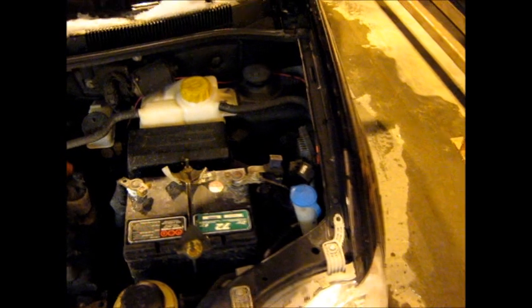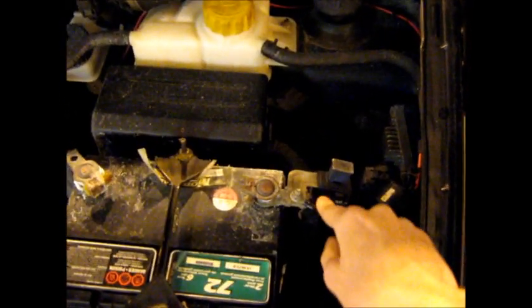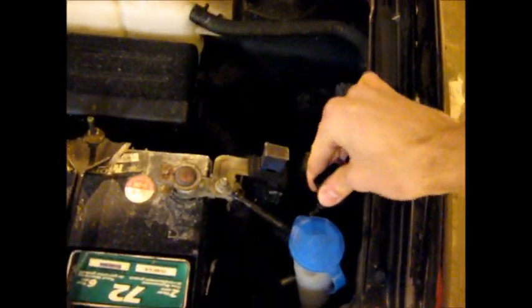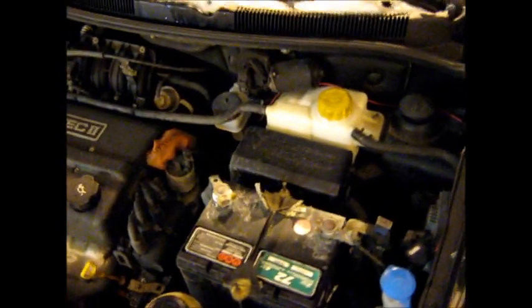So what you want to do is take, I think it was 16 gauge wire, up to the positive terminal of the battery. Make sure you have a fuse on it really close, 7.5 amp fuse, and then run the wire through the firewall to get to the radio. For my car, since it's a manual transmission, the shifter was going through the firewall, so I just used that. But usually there's something by the pedals, like a rubber grommet that you can cut and stick a wire through.